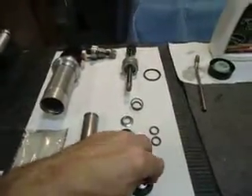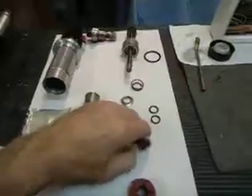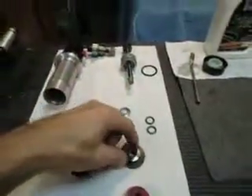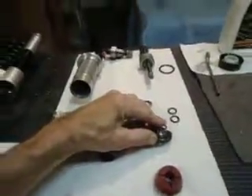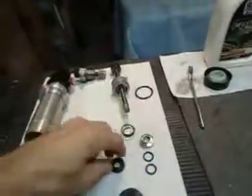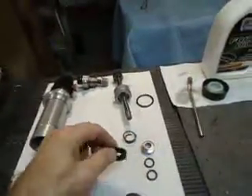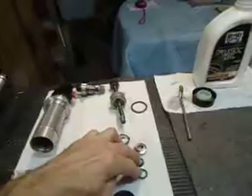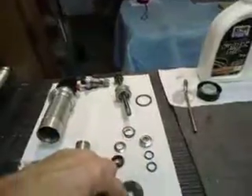This all goes together like that — there's a snug fit. This gets pushed by the spring. With the old one, since it's rubber inside, outside, and around both ends, everything was rubber. It took me four pieces to do the job of these two pieces, but the good part is these are very common — you can buy and replace them quite easily, about ten cents each, and same with this flat washer.